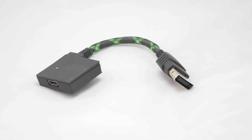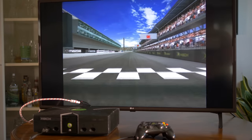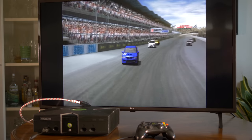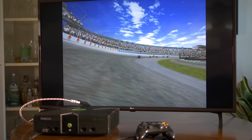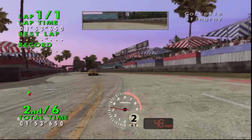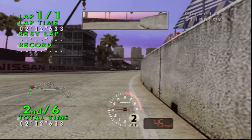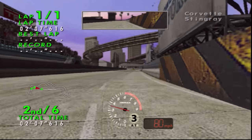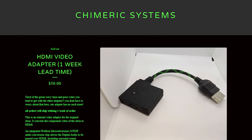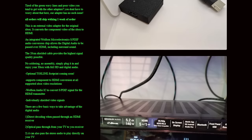One company has been working on their own version of an Xbox HDMI cable designed to have the highest quality analog to digital conversion possible. It's not just the equivalent of the HD pack and quality cables, though — it has a 165 megahertz front-end filter, and the digital filter for the 10-bit ADC is generated from the clock frequency. What this means is that this converter is designed for the exact frequencies of the Xbox and isn't just a generic ADC. It might not be a huge difference over the high-quality shielded solutions, but it's a difference any hardcore Xbox fan would appreciate. The cable also integrates the Xbox's digital audio, is compatible with all resolutions, and might be the best plug-and-play solution available for the original Xbox. And my favorite part? It's only $50 — basically the same price as a used HD pack on eBay.